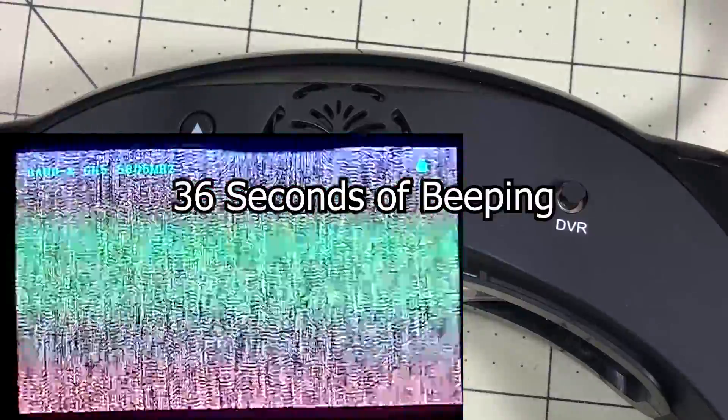Now I'm going to plug in the power and see what happens. Lots of beeping. Well, that was unpleasant. Turn it back on — if the upgrade worked it won't beep again, it will just boot normally, because it actually deletes the file if it upgraded successfully. It didn't beep again, which means we upgraded. I'm going to go in and check the version again just to be sure — yep, that is the upgraded version.